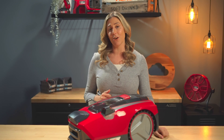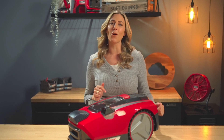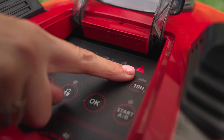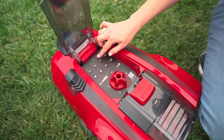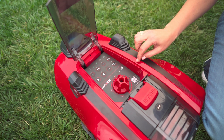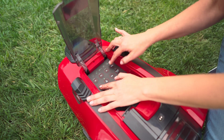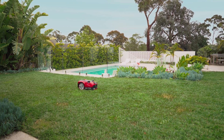And finally, if the exclamation icon is red, it's time to gently roll the robot mower over and give it a reset. You'll also have to reset the GPS data. To do this, ensure that the robot mower is powered on and unlocked. Now press and hold both the home and the 10 hour buttons down for three seconds. The mower will now remap your yard.